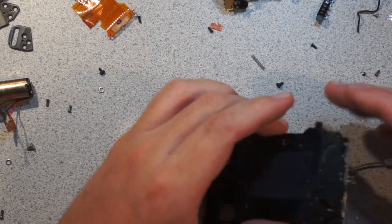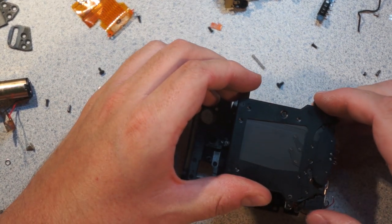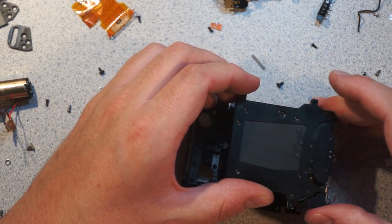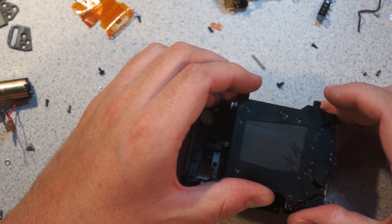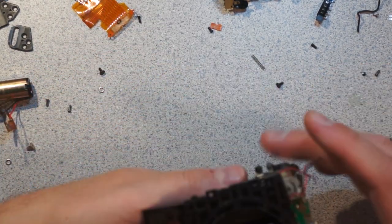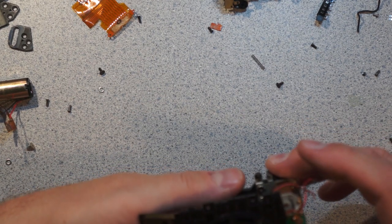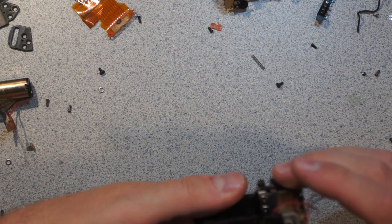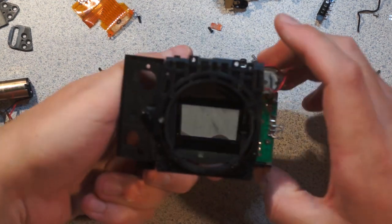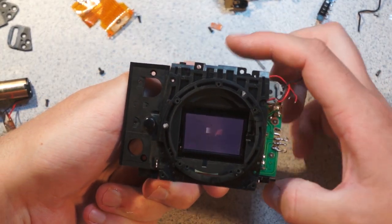You can see how, when this cycles, you can see how this cycles the two shutter curtains. So, right now they're close enough that the electromagnets can successfully latch and pull them in. And so what happens now is the mirror is down. And then when the mirror lifts up, oops, the curtains go the other way. But normally that wouldn't happen, because normally the electromagnets would retain the curtains in their place. Actually, that's interesting. You can kind of see the little aperture for the autofocus.